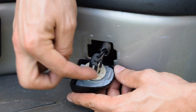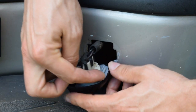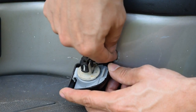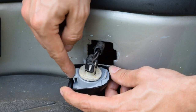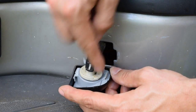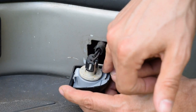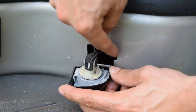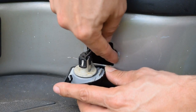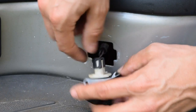On the back of the lens, one side is what I'll call a hook, which is going to hook under the lip of the bumper, and the other side is a clip that will kind of snap into the other side. This thing is keyed so that you can't put it in backwards — the hook is narrower than the clip, and the cutout in the bumper is the same way. This is the narrow side for the hook and this is the fatter side for the clip.